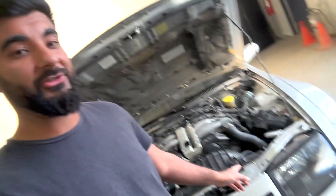The reason I was checking my compression is because I bought thousands of dollars worth of parts to boost my car. As you can see, it's an NA motor. Before doing that, it doesn't take that long — it doesn't hurt to check your compression. Before you buy parts, before you try doing anything with your motor, check your compression. I bought my parts ahead of time, I knew I had good compression — I did a compression test when I was buying it. So I knew the compression was okay, but just for peace of mind I wanted to do it again right now.